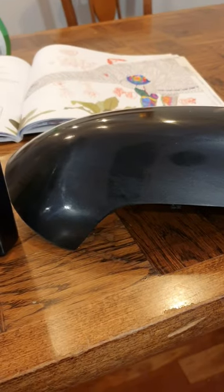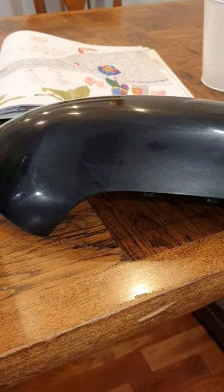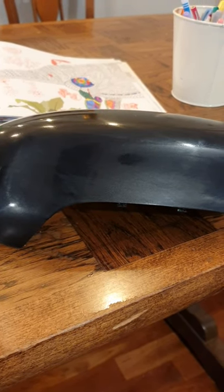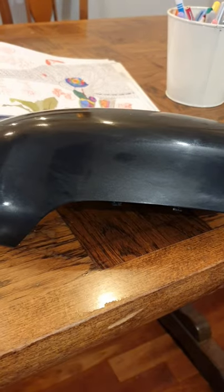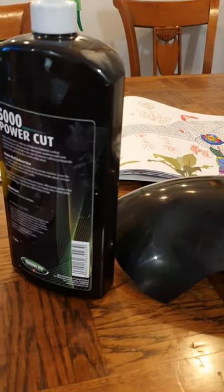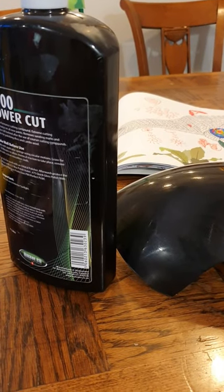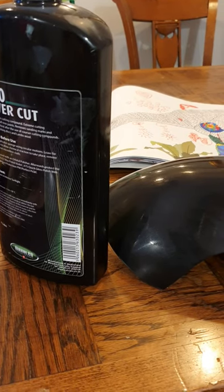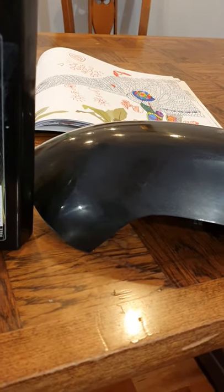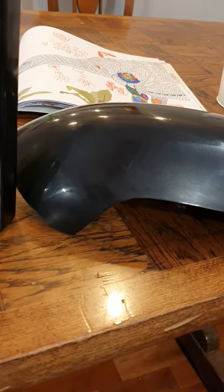I've used the compound, but just before doing so I used very very fine abrasive paper to remove any little raised areas. I smoothed it off with wet and dry very lightly, then used compound from Halfords, which left some very fine scratches. So I then used this product from Maxill which is 5000 cut — a diminishing grit technique — it starts off quite coarse and then cuts right down to fine dust, removing all the finest scratches. This will set for about 5 to 10 minutes and then I'll polish it off.